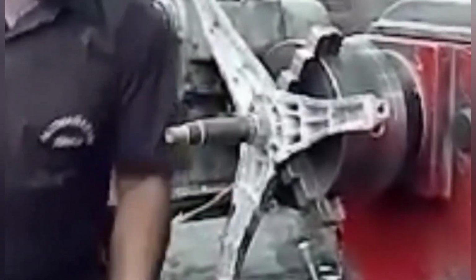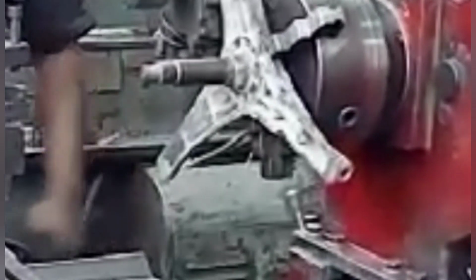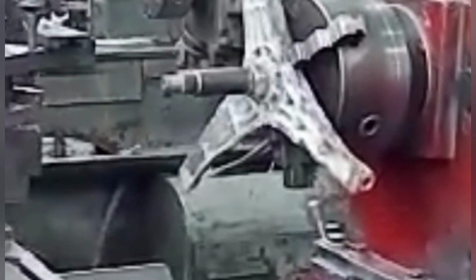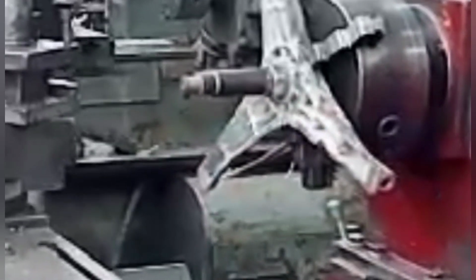The seal measurement and bearing with the seal, 6206 bearing, are the same. This old shaft, we have to cut only the end. The end of this shaft is a little bit bigger. It's long, we have to make it short. Only after that can we fix it here. We have to make the end to the 6205 bearing size here on the shaft. Take the measurement and we have to cut here.